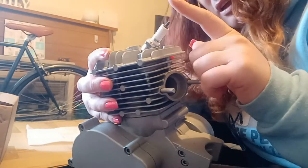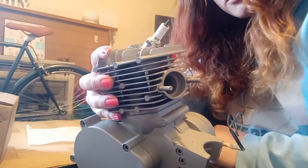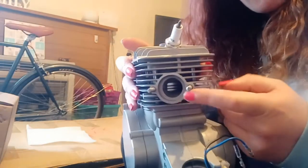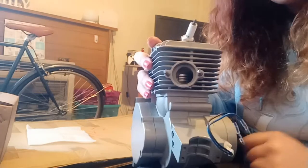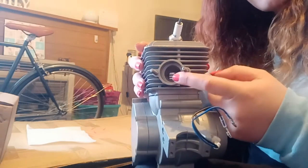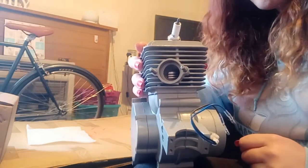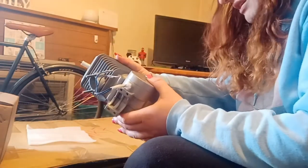I dislike the spark plugs being shipped mounted in there, because I feel like there's a chance something's gonna get broken. So we're gonna take all this apart and have a look inside the cylinder. On my BT-100, I crushed the copper gasket and ended up just wrapping it in Teflon tape with no gasket, and it ran fine — barely leaks. But this time around, you get one shot at mounting that copper gasket, so I'd rather seal it properly, because finding replacement rings is near impossible.